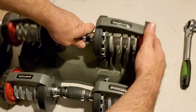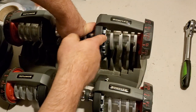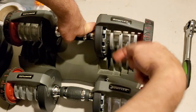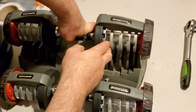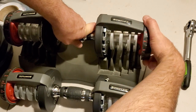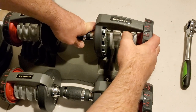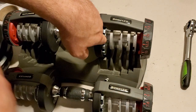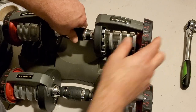The other thing that can happen is you can turn the dial, but you can hear the struggle of the ball bearings trying to correctly move around, or this plate trying to move with the ball bearings switching between the different holes on this plate. Look at how loose this is — and again, this is tightened plenty, but it's still missing washers here, which means that the entire assembly is still going to have a looseness to it.